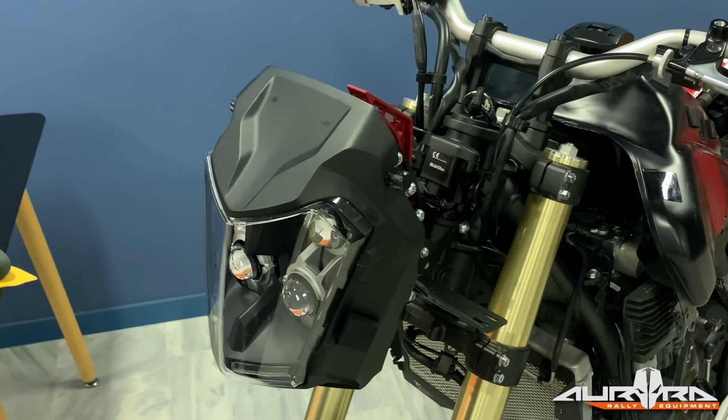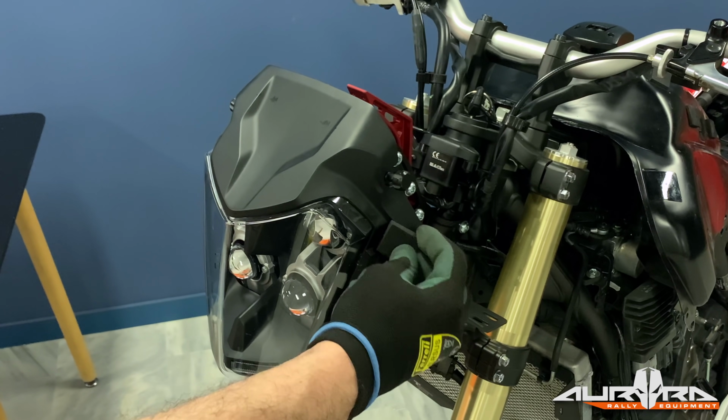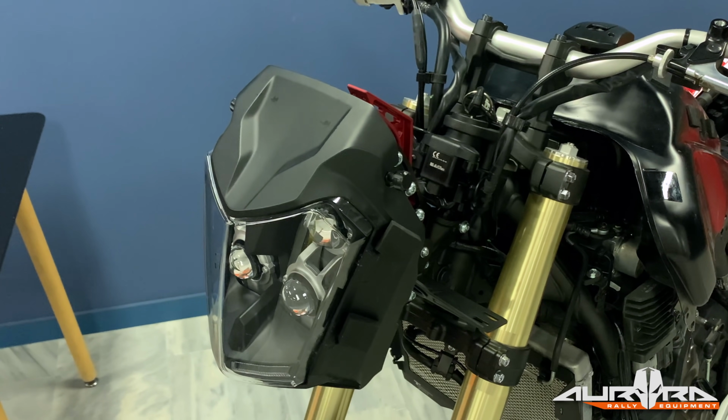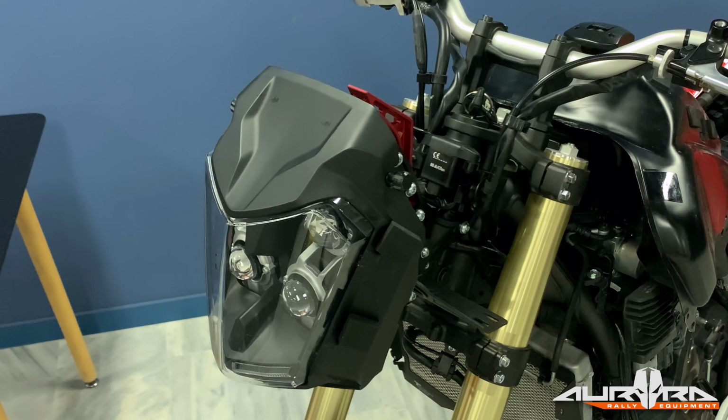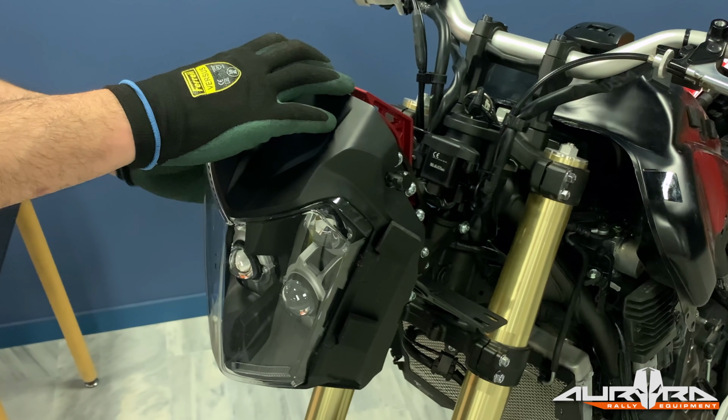Before mounting the backplate support and the windshield brackets, put some EVA foam on the headlight to protect it from the windshield bolts. Apply EVA at the exact same positions on the other side of the headlight.